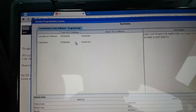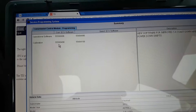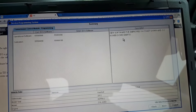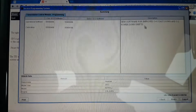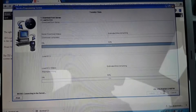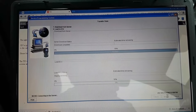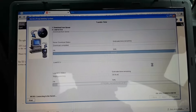There is a newer version available. The current software is the old one - as you can see in GDS2 those numbers match what's in the car - and this is the new version, with notes on what the improvements are. We'll just press next and allow it to do its thing. It's now flashing the module - actually quite quick.